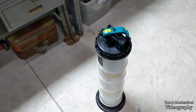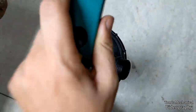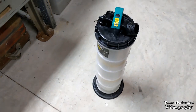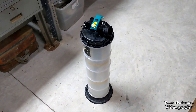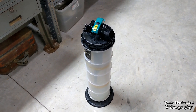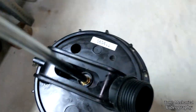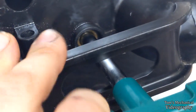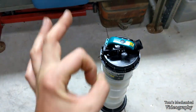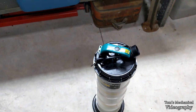I've got a problem - this sucky boy really sucks at sucking. I already went in there once and greased up the plunger on the inside, thinking that was the issue, but I just washed out all the grease with brake fluid or something when I was sucking something out. I think the real problem is this o-ring down in here - that's how much play I have just in the upper part of the handle, which should probably be a crisp zero. So I'm thinking that o-ring is shot somehow, got sand in it or something.